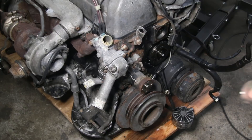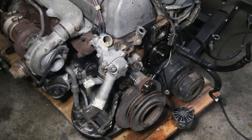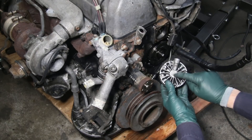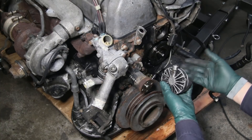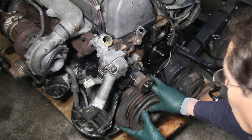You can reach down in here and actually lift on the water pump to make sure it's tight. If you have a wagon with an SLS hydraulic pump, that pump could also be making noise — the shaft could be worn out. I've already taken this apart, and the shaft and bearings are fine in the SLS pump, so that's not the problem here.